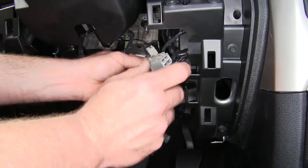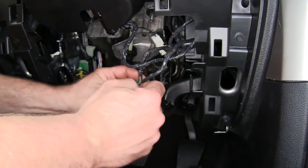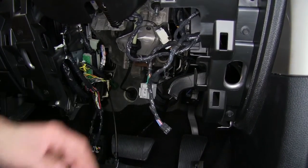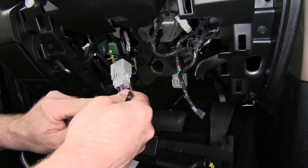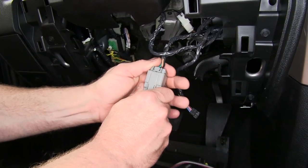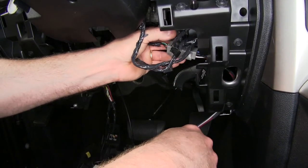Your factory wiring is going to be taped on with a little piece of tape — ours had actually popped loose. You're going to find a gray plug with four wires: a green, a green with a white tracer, an orange, and a black. Take the new connector — it's also four-wire but in different colors, and that's okay, they're going to match up. Snap it into position, listen for the snap, and give it a nice tug. That's all we need to do to attach it to the factory wiring.